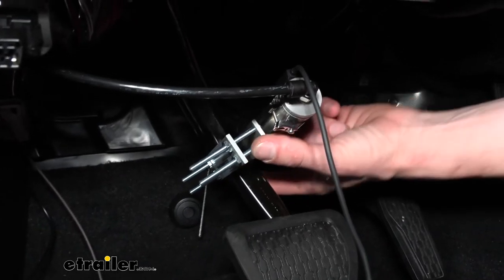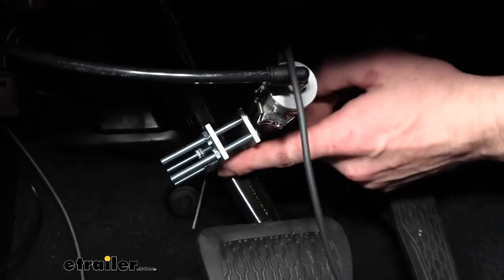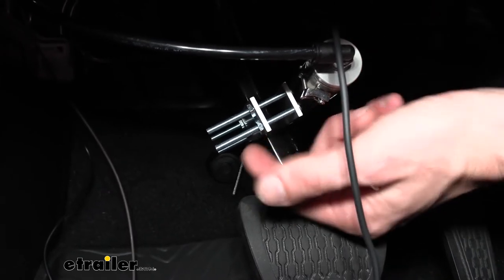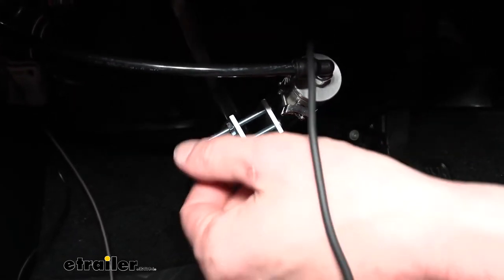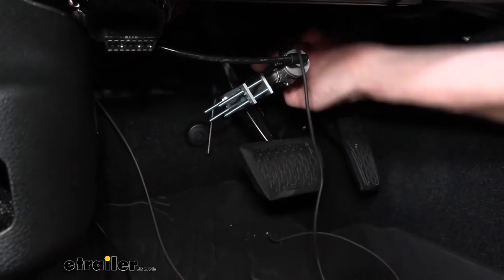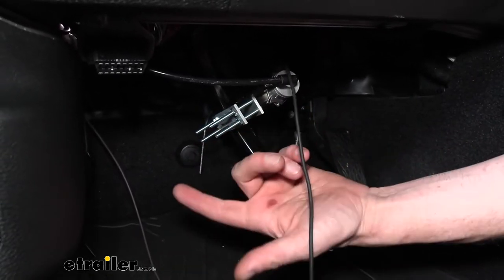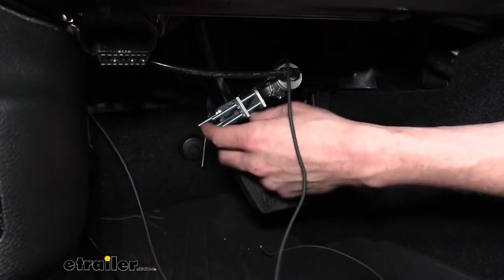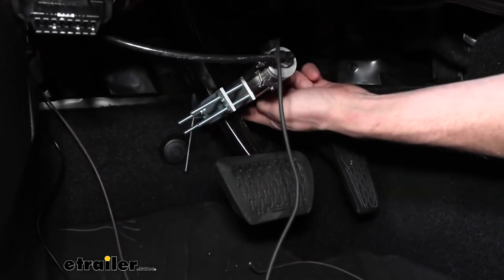Reinstall the plate with the two Allen screws once you've got the longer bolts on there. The cylinder simply holds up to the pedal with the bolts straddling the pedal shaft, then slide the other bracket in place and secure with the nuts. Use just a 3/8 socket in your hand with no ratchet — you want it tight enough to slightly flex the bracket, but if you over-tighten and bend the clamp bar it won't hold anymore, so it's important to do it by hand.